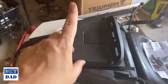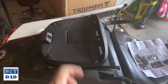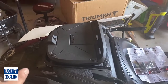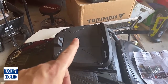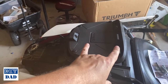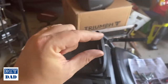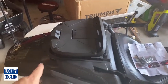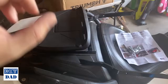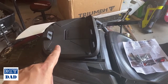Normally with this top case you get bolts that come down and a wing metal bar so that when you tighten it, that holds against your luggage rack. I got this specifically for a bike I don't own because it was available on eBay — we'll talk about that later. So I have a mounting plate that's meant for a Kawasaki, but that plate will actually line up underneath my rack and bolt directly into it still. Because I'm dealing with a custom metal plate under a metal rack, I'm going to put a couple pieces of foam on. I'll mount the plate to the rack first, then place the entire assembly on the bike — it'll be a bit easier to go that route.